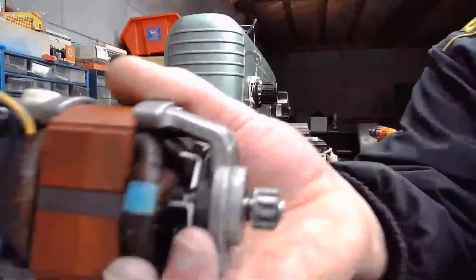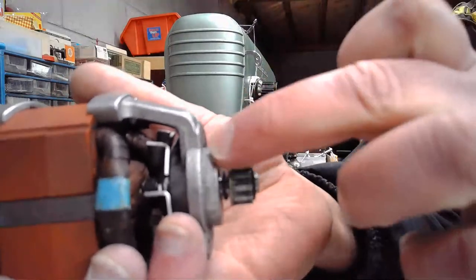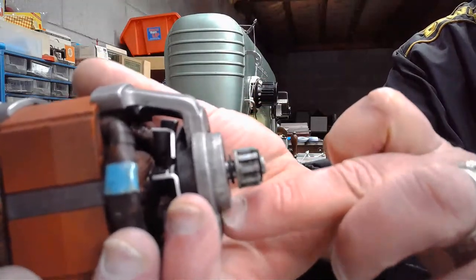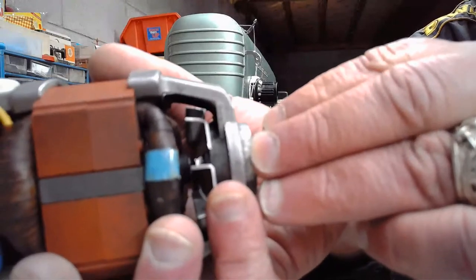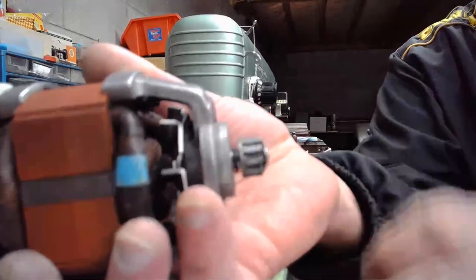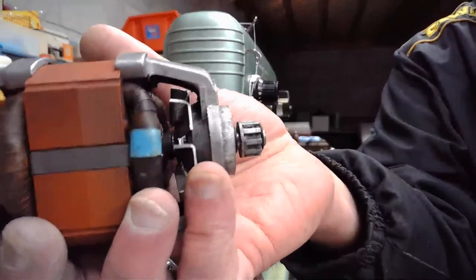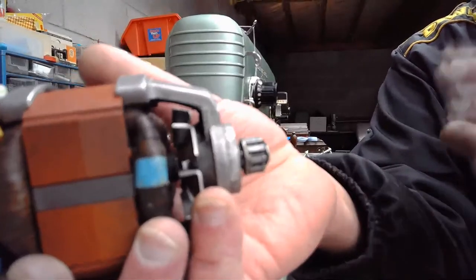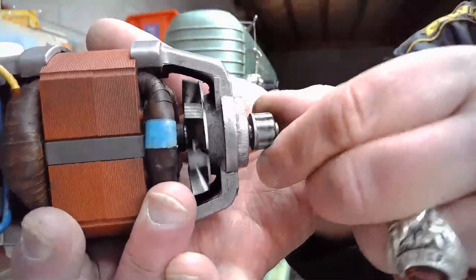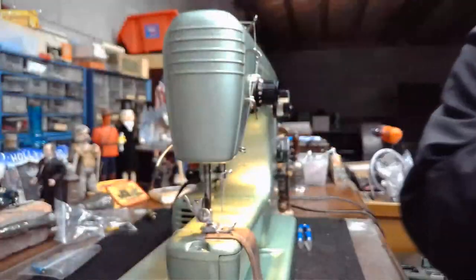Yeah, you can absolutely fashion a suitable motor mount, or you can supplement the one that you have that's been compromised and just build it up a little bit with oil resistant gasket type maker material, and you'll be able to keep that motor in a nice fixed position. Because probably what you're getting now, when you're trying to kick that motor in, because that motor mount over here has failed, is a flexing of that motor, which you definitely don't want. This should be in a fixed stationary position as that pulley and motor engages, and it should be riding without pitching in any way.